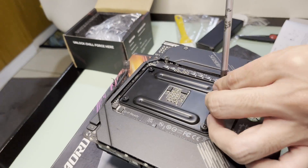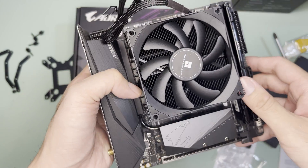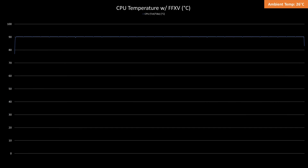It is still best to tighten the nuts three turns at a time. Lastly, plug the fan to the fan header and now it's time to test this. While benchmarking Cinebench R23 for 30 minutes, it was expected at 90 degrees Celsius on average.